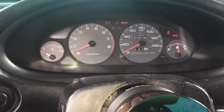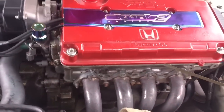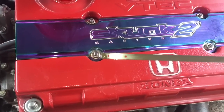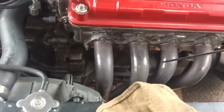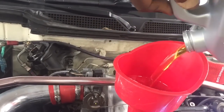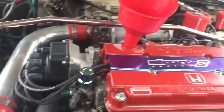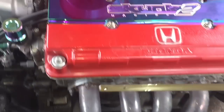I'm still gonna turn the car on to make sure it cycles through the whole engine as well as the oil filter, and then we're gonna re-check the oil and see where we're at. If we need more, we'll just top it off. Oh see, this is why you turn your car on after you do it — look where our oil level is at now on the dipstick. That's why it's important to turn your car on, then check the oil level again, and top it off from there. Now we're good — exactly where we need to be.